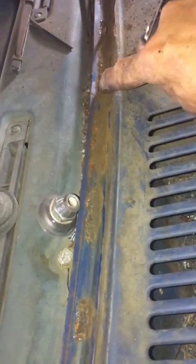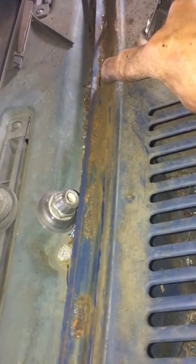The only other area of rust on this truck that is left — and this is quite common — on the passenger side, I've already got this cut out, but the top layer was completely rusted. There are the pieces of it, and down in here some that rusted through — right here. So I'm going to end up cutting this out as well and welding a new piece in here. Then I'm hoping to save this little area, and there's a rust hole there too, so I'm going to have to weld a piece in there.